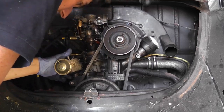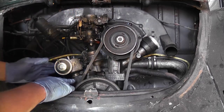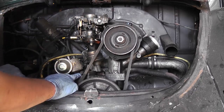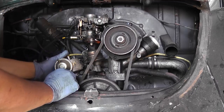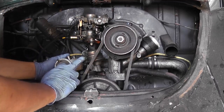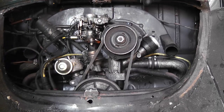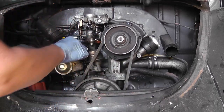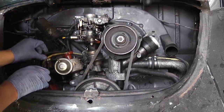So as not to upset the timing on this engine, we're going to leave the clamp on the back of the distributor. There's a nut that holds on that clamp along with the distributor further in. So what we'll do is we'll rotate the engine around to number one cylinder top dead center. You can see straight away you've got one different HT lead as well, so I think what we'll do is stick a set of leads on as well.